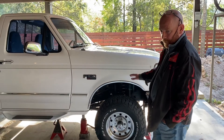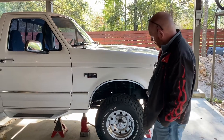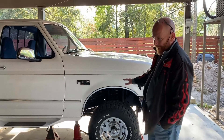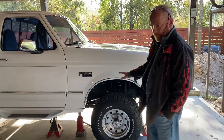When I measured it, I found you only get just over four inches of travel, which seems ridiculous. The shorter shock is limited to four and a half inches. With a bit of figuring out, I reckon you can get this to about eight and a half to nine inches of travel using the airbags.